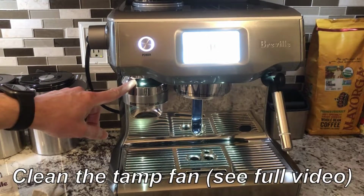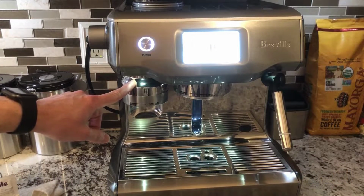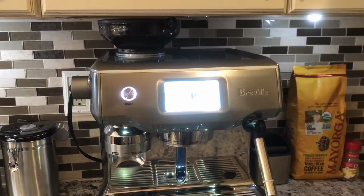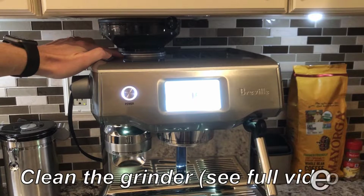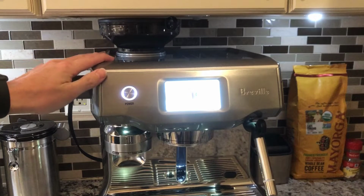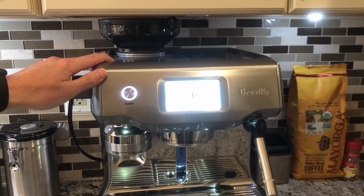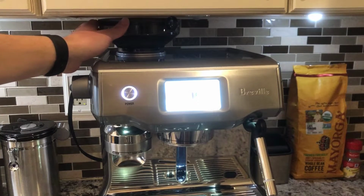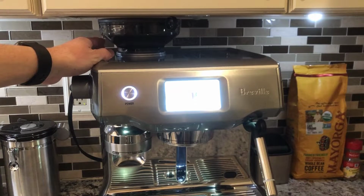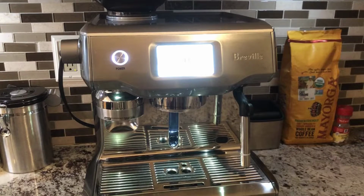You should clean the tamp fan, which is a pretty easy process using the tamp fan removal tool that is stored in the tool tray under your drip tray. You should clean the grinder, which can be a lengthy process, but if you use something like a vacuum, it makes the process a lot easier. And lastly, you want to wash the hopper. Empty the beans first, then wash the hopper with soap and water, and make sure you let it thoroughly dry. I have videos for each one of these tasks, and I will link them in the description of the video below.